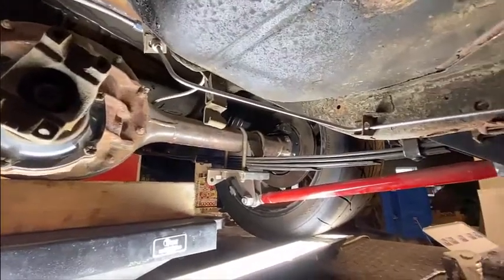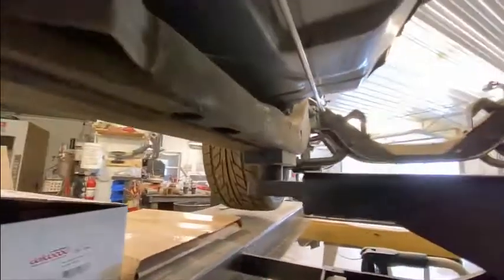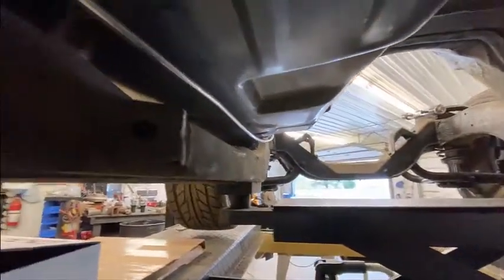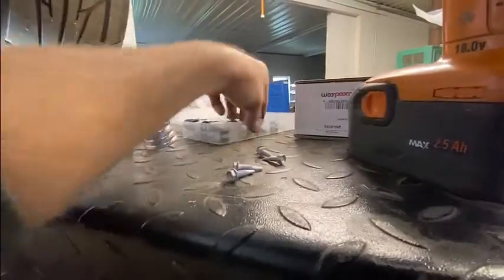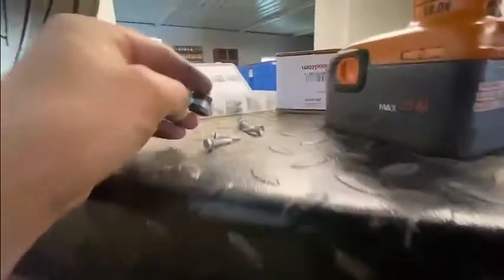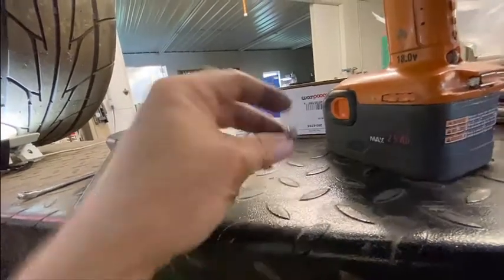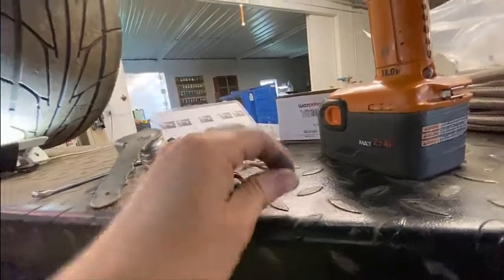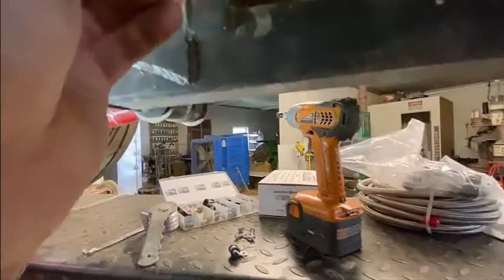Here's the end - I started bending this to fit the contour of the car by hand. As you can see, this is going to fit closer to the frame rail just like that. What I'll be using are these clips - the bigger ones and the smaller ones here - with some zip screws which have a bit on the end. I think I got these from Fastenal and they work really well for frame or any thick metal.